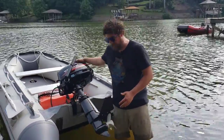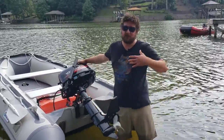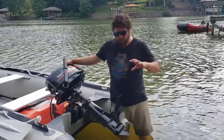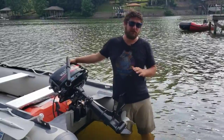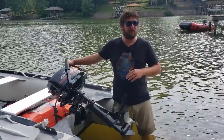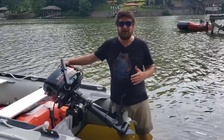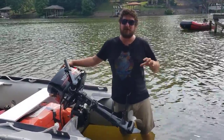That's our view from the bottom. We did take this out and test it a little bit to give you a good notion of what it actually does. It definitely hits that plane faster overall, and it also seems to hold that plane when you're going through turns. It did knock about a mile an hour off the top speed — we were able to top out at about 13 most days, but now it's 11 miles an hour. It's steady and doesn't seem to fluctuate on speed when you go over wakes or when you're turning.